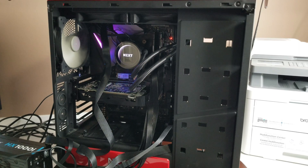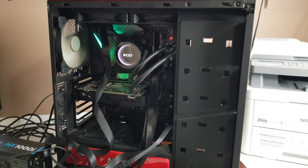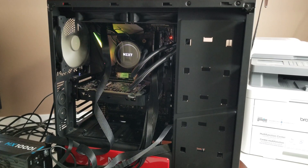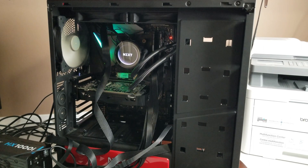A couple more things I did here. I left the other power supply in, but I don't think that was the issue — I know now it was not the issue. The memory. I should have started with that in the first place — rookie mistake. When somebody told me it was a power supply issue, I immediately started checking there. I should have started with the memory, because when I went and checked, the sticks were not fully seated — they were not fully inserted. Once I did that and powered it on, the system is now working.